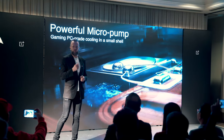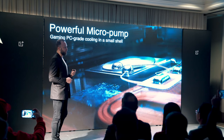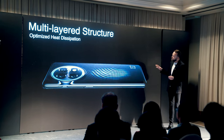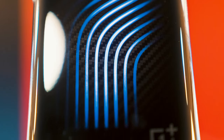To circulate the liquid throughout the device, the OnePlus 11 Concept uses a piezoelectric micropump that is one-twentieth the size of a conventional impeller pump. OnePlus claims the system can reduce temperatures by up to 2.1 degrees Celsius when gaming, leading to a frame rate increase of 3 to 4 frames per second. It will also cool the phone by 1.6 degrees Celsius when it's being charged, which enables charging times to be shortened, albeit by only 30 to 45 seconds.